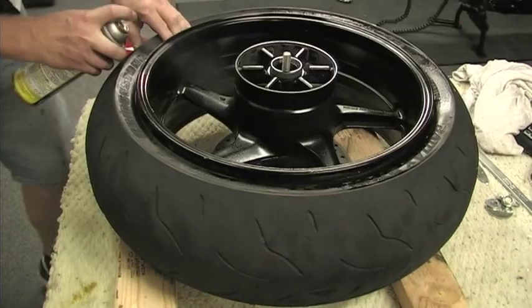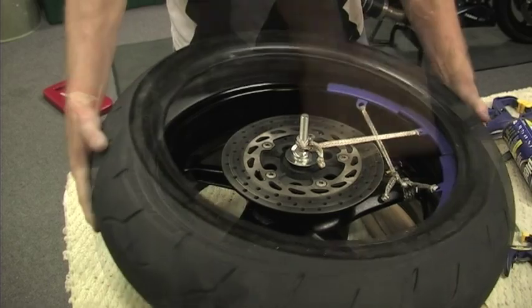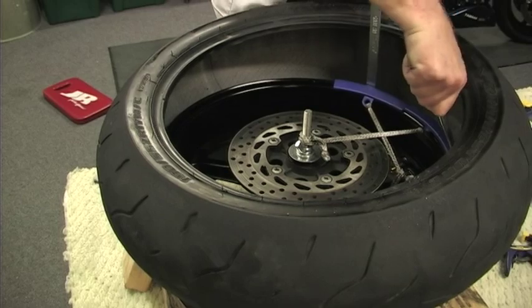Flip the wheel, apply the Pledge, put it back on the blocks and tighten it down. To get the tire off, I am using 3 rim protectors, but I am now using a 5-inch block at the rear to position the tire bead into the center of the wheel.